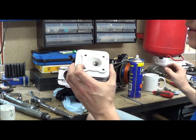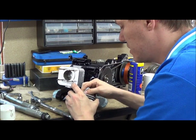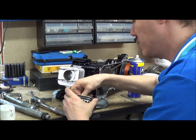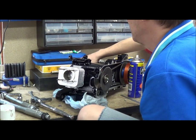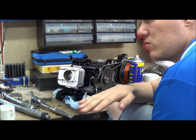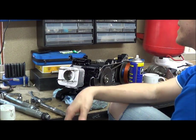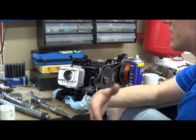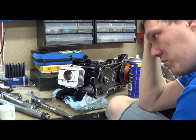Make sure you clean all that scum and residue off, and you're ready to rock and roll. Now the adjustment: we've got 1.6mm, and the gasket's probably about a mil, so we can take that out and that'll drop it to 0.6. So we may have to stick a thin base gasket in there — we'll see how we go.